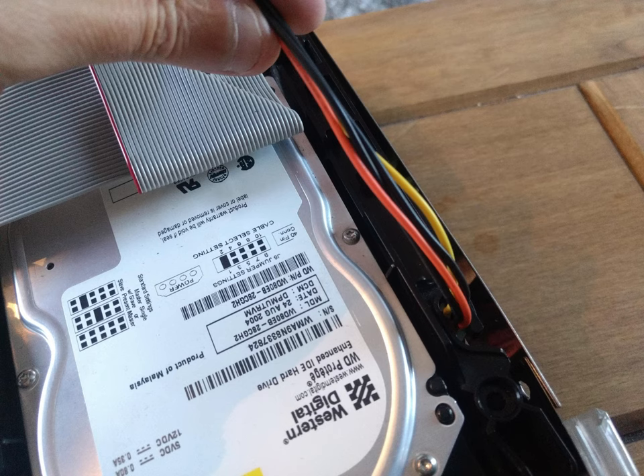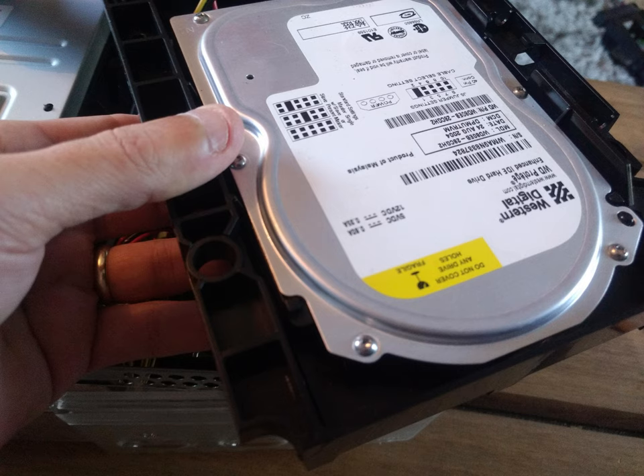Before you remove the hard drive you need to unwind the power cable. It's in the groove at the right-hand side of the hard drive — just take it out of its groove and out of the clip at the bottom. It just makes it easier to maneuver the drive. Now you can move the hard drive out of the way. There's no need to remove it completely; you can just sit it to the side slightly.